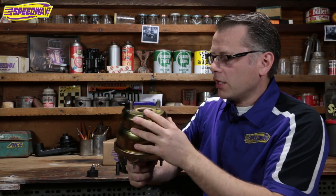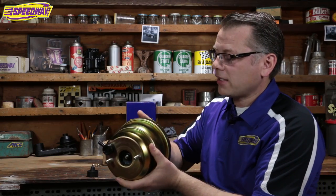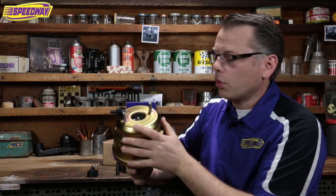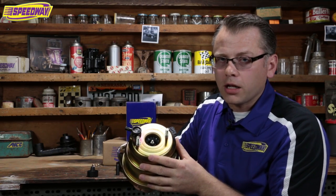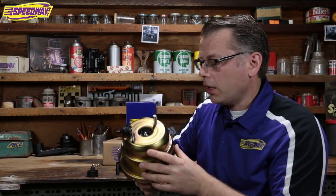It's a really tricky thing to get a wrench on — it's kind of buried down in this hole and it's a pretty small wrench at that. What I'll typically tell guys to do is put this on a pedal assembly, have somebody push on the pedal and it'll poke this thing out, and you can have somebody put a wrench on it and get it adjusted to where you want. You can use a little piece of clay on there to make sure you have the right clearance. We like to have a little bit of a gap — a sixteenth of an inch is pretty good.